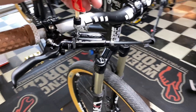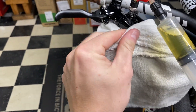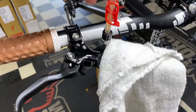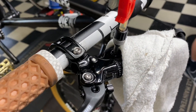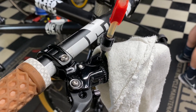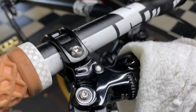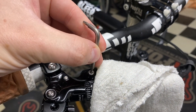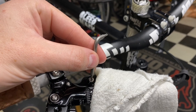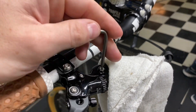What we're going to do now is unscrew this — you're going to see some fluid come up, so grab a little towel like this to catch the overflow. It's going to burp out a good amount — that just means it's pressurized. Don't touch anything or squeeze after this. Go ahead and put the screw back in there — this DOT fluid is very corrosive so after this is done you're going to want to hit it with isopropyl alcohol. Righty tighty — make sure it's good and tight.